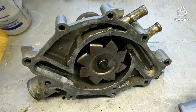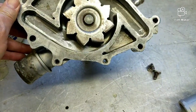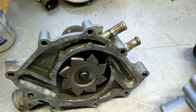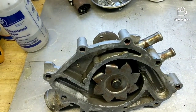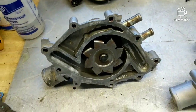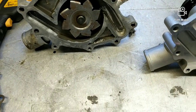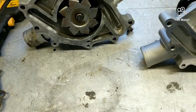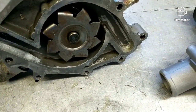I got a water pump I just took off the LTD - it's still kind of moist. What was going on was the LTD, when I was driving it, it was fine, but when I get into traffic or sit idling for a little bit, the temperature would start creeping up and get over 210. I used a temperature reader and found the water was coming out of the thermostat fine but it wasn't getting up to the radiator as well as it should.